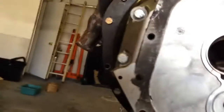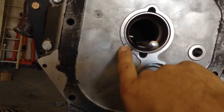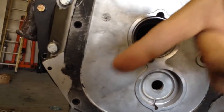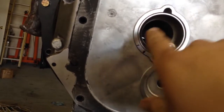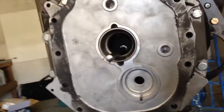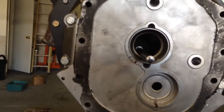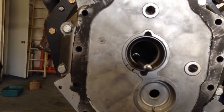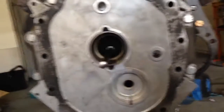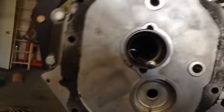In my case, because this is the low spot and my high spot is at about 23 thousandths, I need to move my bell housing in that direction — right down that line. If you draw a line splitting the high and low spot, that's the axis you move along. Moving 14 thousandths should put me within the 5-thousandths spec, ending up about two and a half to three thousandths out — assuming everything goes according to plan.